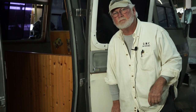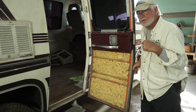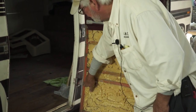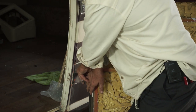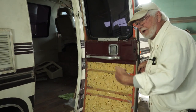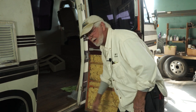I'm going to show you another '73. We open this up — no movement. But this door has damage. This is a square channel, thin wall aluminum frame on this door. The hinge is a quarter-inch thick steel hinge. So if there's going to be some binding, what do you think is going to give? It's going to be this. The thing cracks and it's inside. The real fix is to cut this open, weld it from the back side, and put it all back in.